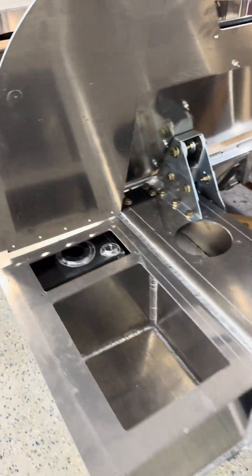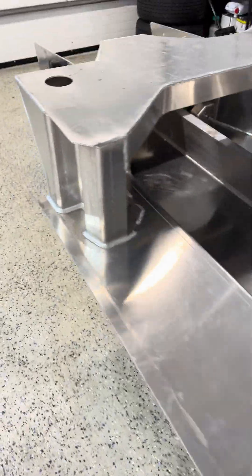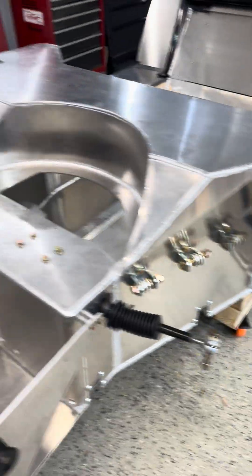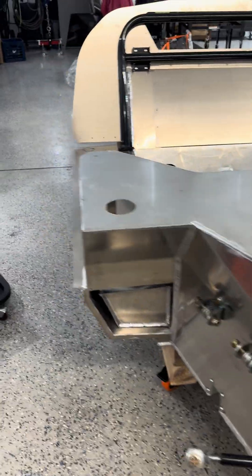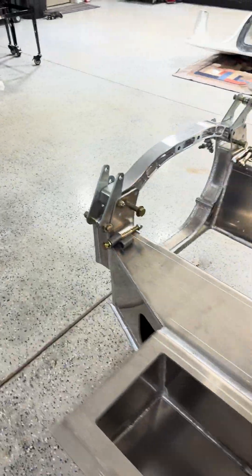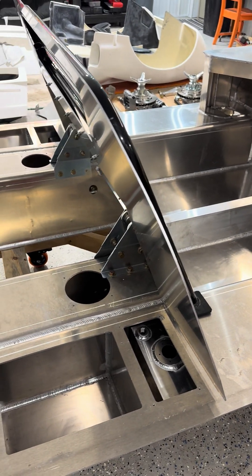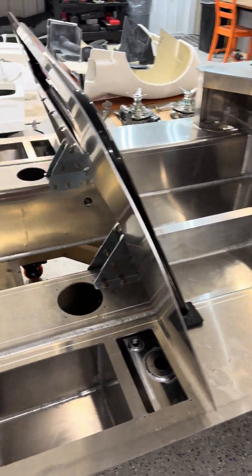I pulled off all of the access panels. You can see in here — there's the fuel tank. You've got a fuel tank on both the left and the right, so it's a dual fuel setup. A lot of guys running fuel injection spend a lot of time figuring out their fuel plumbing, but since I'm carbureted — much to the chagrin of a lot of people who wished I was running a Coyote — I'm just going to have an A/B tank switch. Just like an old school pickup truck, tank one, tank two. Just going to mount a toggle on the dash.